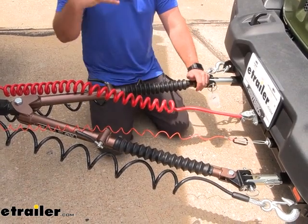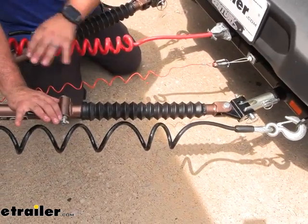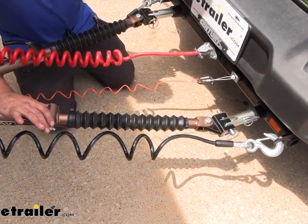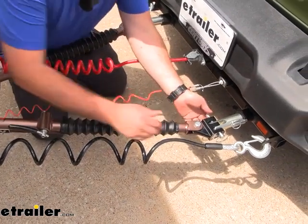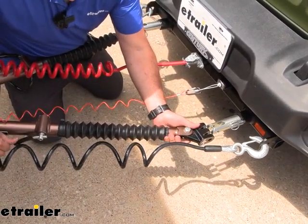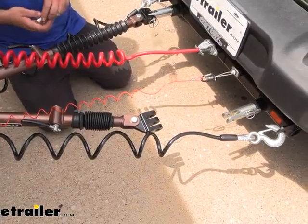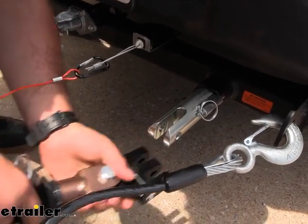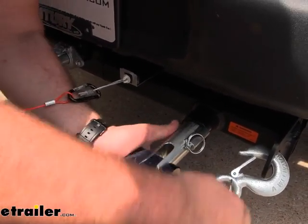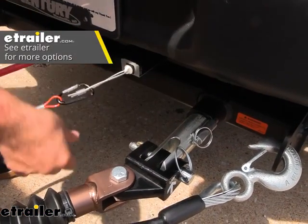Some of the features that I really like and recommend to everyone is the non-binding style. Some older tow bars, once you're in the locked position after towing, are really hard to separate and draw the arms back — you have to make sure it's on perfectly flat level ground. But that's not the case here. Ours is non-binding, and you can see it's locked here. I'll just simply push this down and this allows us to draw that arm back nice and easy, even on unlevel surfaces. As far as adapting to your base plate, we have a Blue Ox base plate on our Wrangler today, but not to worry if you've chosen a different style like Roadmaster, Demco, or E-Trailer — you can pick up adapters to put on your tow bar and it's still going to hook up.